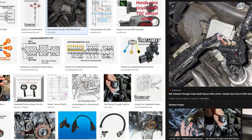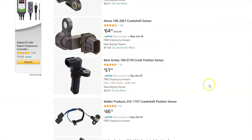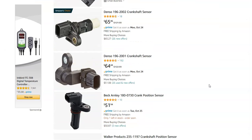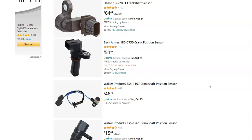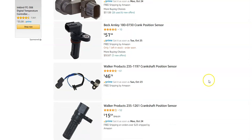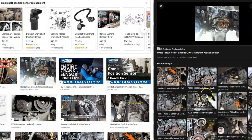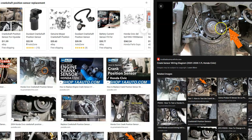If you check all the wiring and it all looks good, then it very likely is the sensor. The sensors are a low-cost part. Looking on Amazon, they range around $26 to $65, so they're not extremely high-cost items — quite often you can get one for like $20 to $30. Depending on the location of the sensor will be the main challenge. Some of them will be really easy — like this one right here, you would just unscrew the bolt, pop it out, pop in a new one and you'd be done. While others, like this one, you'd have to pull off the timing belt cover and come in there, so that's a bit more of a pain.